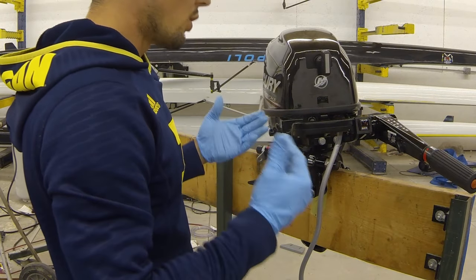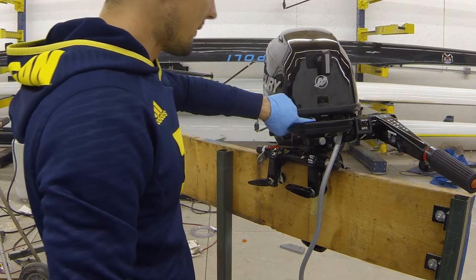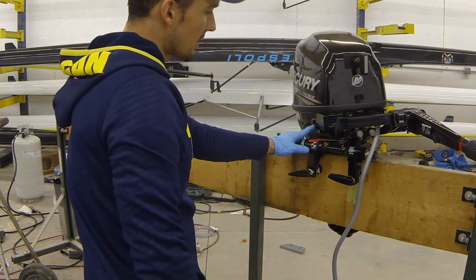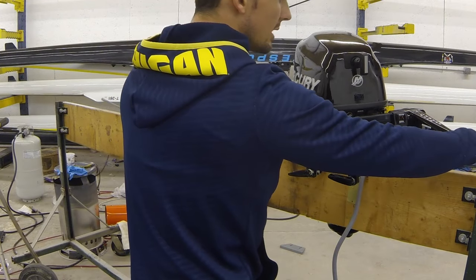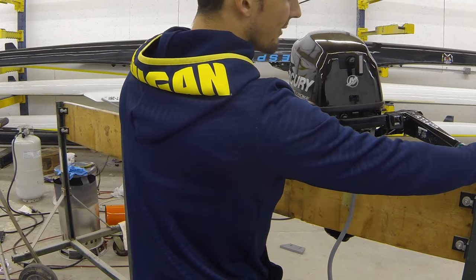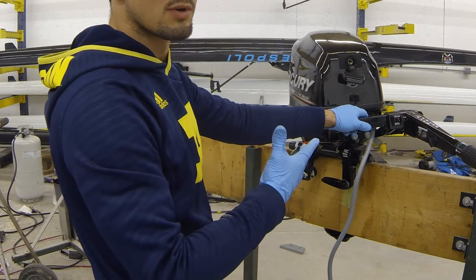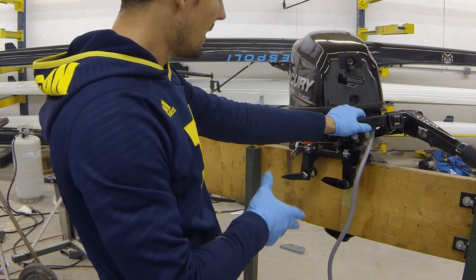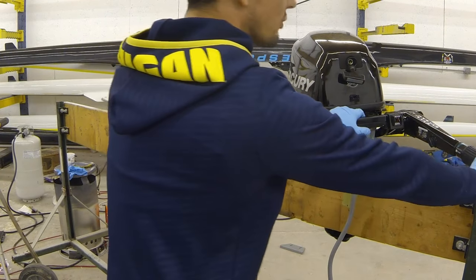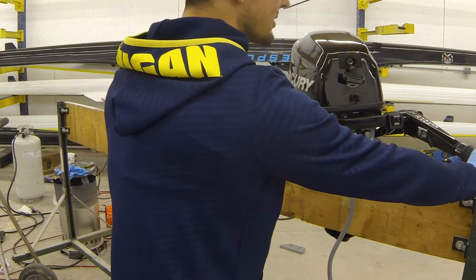If it's a really cold morning and you're trying to get this motor started, you would use your choke to give it a little bit extra fuel, and maybe even push on your throttle-only button on the side. Push the throttle-only button in while twisting to about a quarter to half throttle — if you're not sure where that is, twist it all the way to full throttle and then halfway back. Give it a nice big pull, and that'll help give extra fuel and air to get the motor started a little quicker. An important thing to note is that when it starts up and the motor is running at high RPM, you want to bring it back down to neutral or idle speed as quickly as possible so you don't hurt the motor when you first start up.